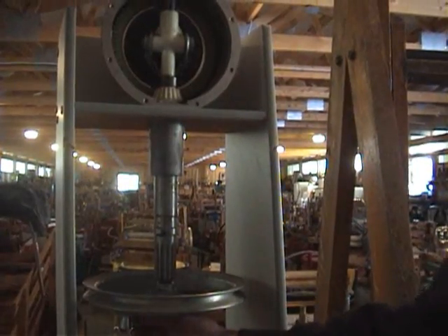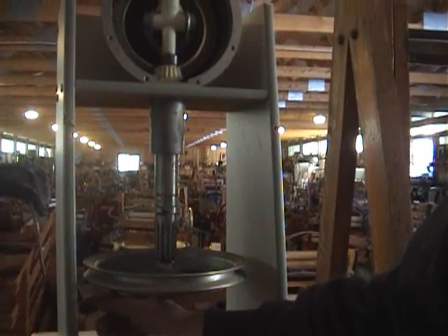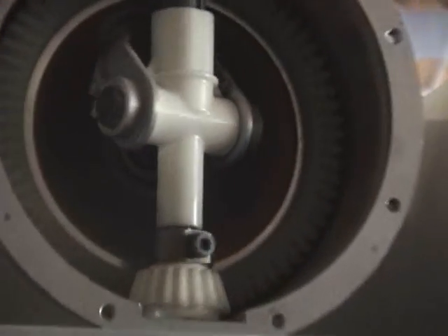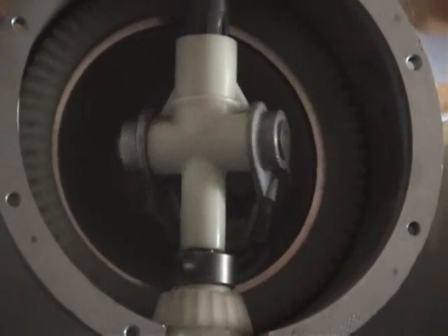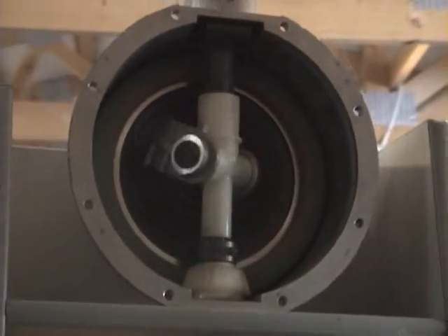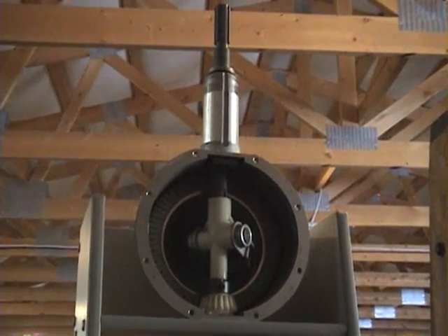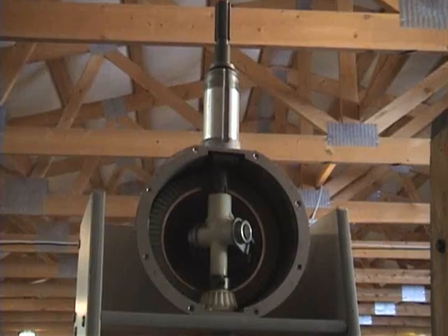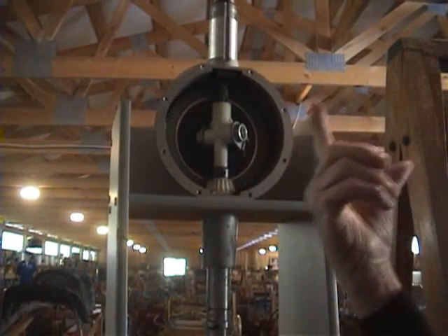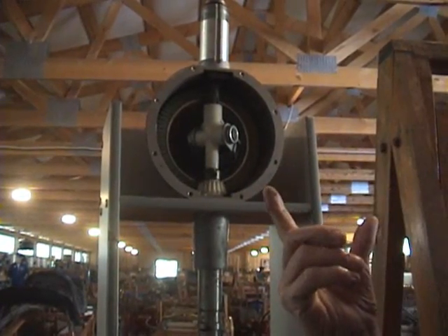The helical transmission — it's their kind of second major generation in automatic. You see, as the pulley is rotated one way, you get the oscillation of the back and forth movement of the agitator. Whereas if you go the other way and reverse the motor, then the thing locks and the whole transmission, which is attached to the tub, rotates for spin cycle.